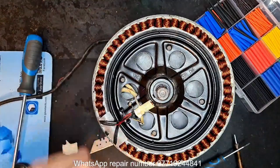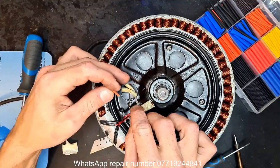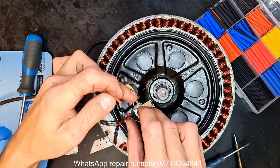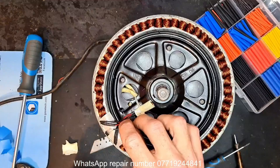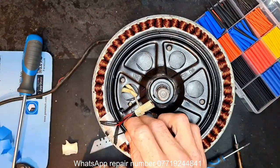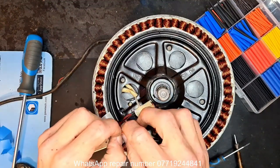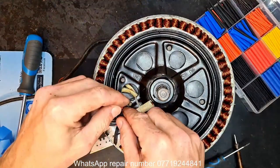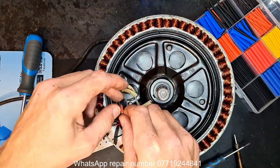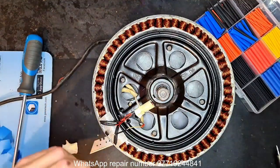It's just a size up, is what it is. And what I'll do is I'll stick this on these legs. Simple reason is when I solder these to the actual pins they're going on, I can sort of drag the heat shrink back over and seal up these tips as well. So that'll be nice. So one, two, and three. Better turn the soldering iron on.